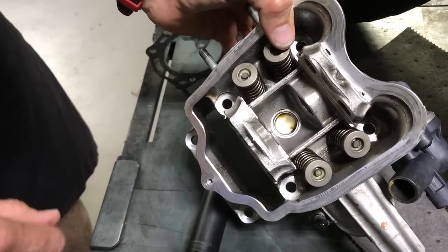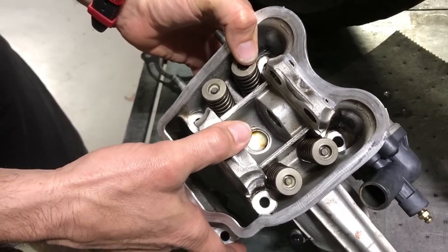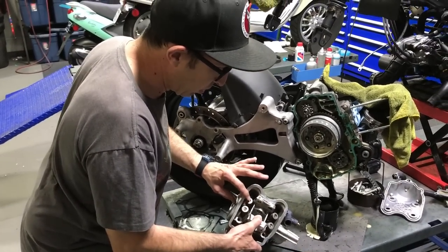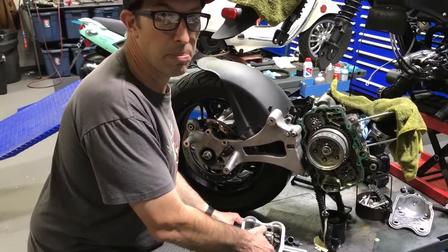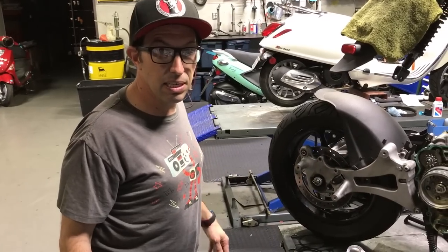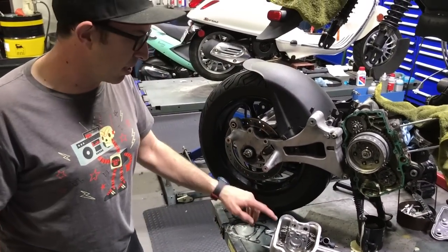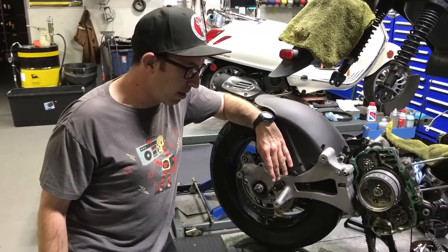What happens is the prior coolant in the system has broken down — the rust inhibitor properties of the coolant. It doesn't really affect the aluminum head, but unfortunately there are other parts of the engine system that are made of steel, and it rusted all the way through that freeze plug in the cylinder head. So unfortunately we're going to have to put this motor back together either with a new cylinder head, or replace that freeze plug, which isn't really available as a spare part.